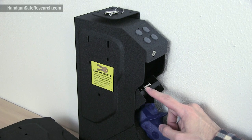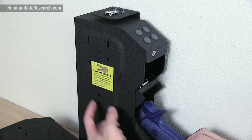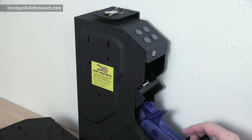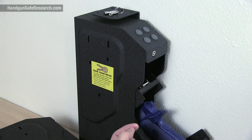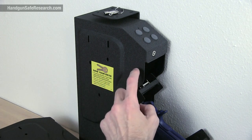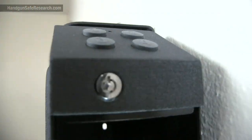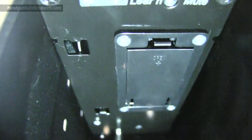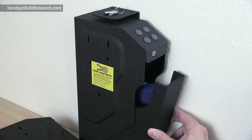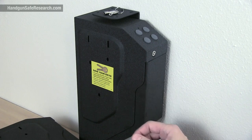This piece on the back of the door is what the latch is holding when it's closed, and the latch is back here. Now, how do you suppose this bypass lock at the front actuates the latch at the back? It does so by pulling on a cable. If you look up inside here, you'll see a hole in the bottom of the housing, and running right past that hole is the cable. So if I can find some way to push or pull on that cable from the outside, I can open this.